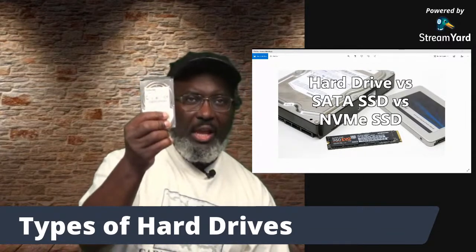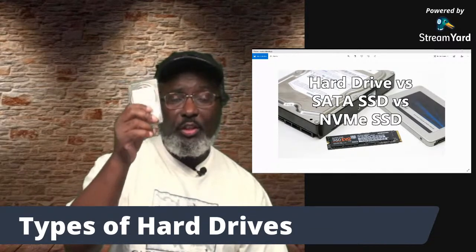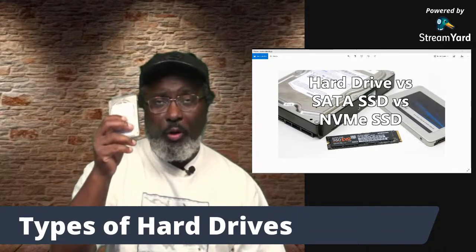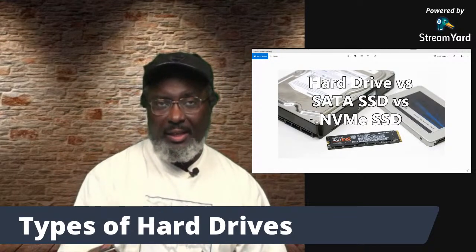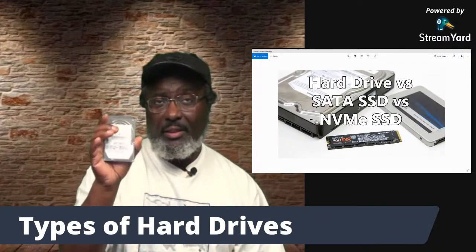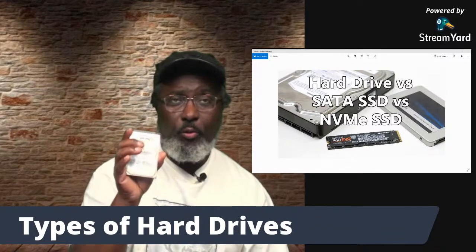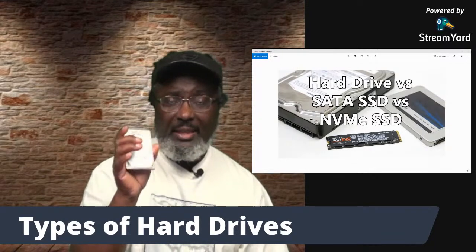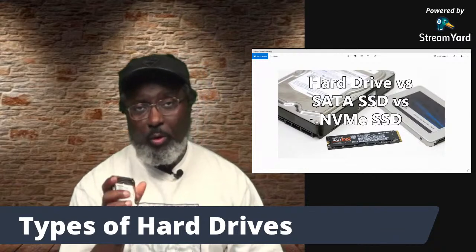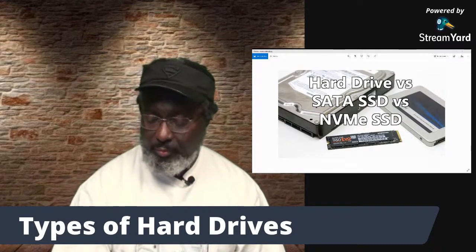the mechanical drive, which is the drive that you want to be really delicate with and not drop or bump. I can really cause damage just by the way that I'm shaking it, because shaking it violently will also move the heads or make them come in contact with the platters. And that's what you don't want. You don't want the heads to come in contact with the platters.